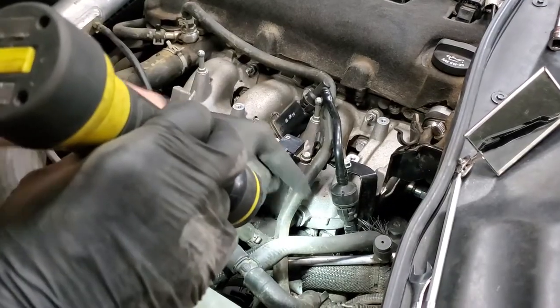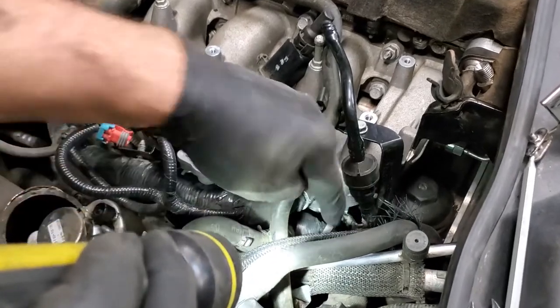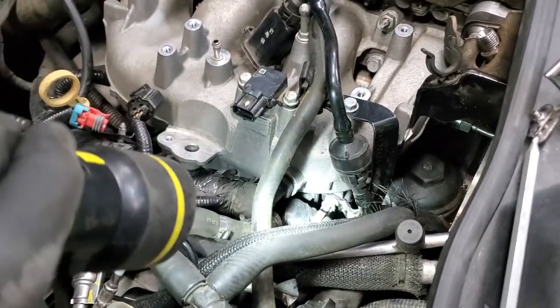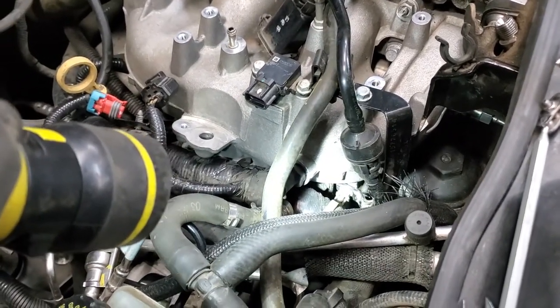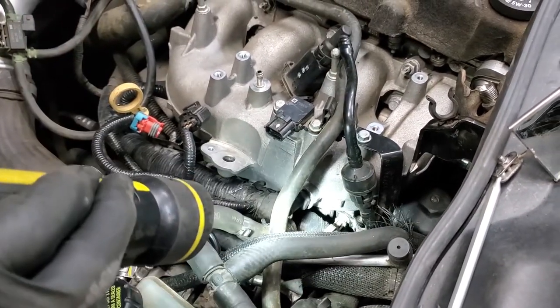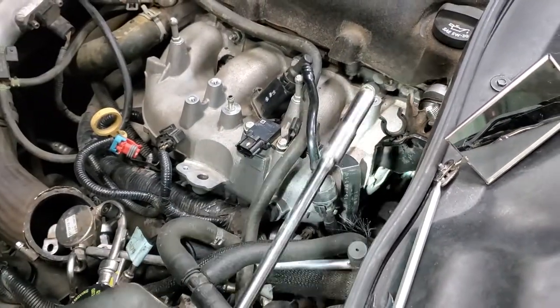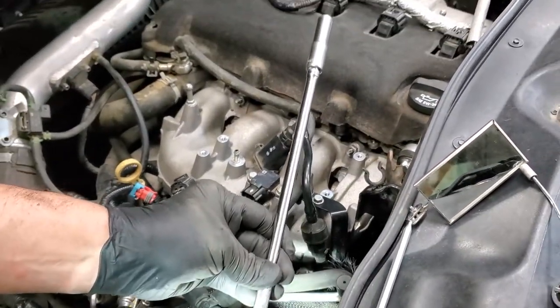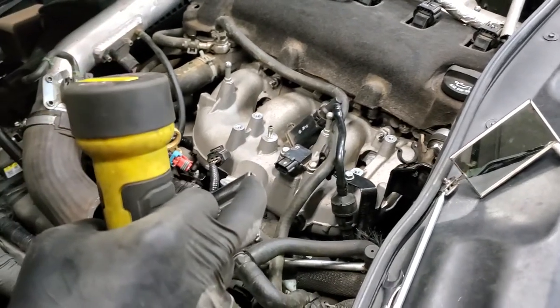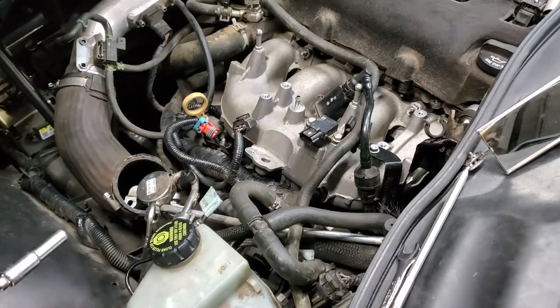All right, down in here, we've got the two bolts reinstalled, the 13 millimeter, which is on this side. And the one that's lit up is that stud bolt. You notice I put the clamp back on here. Now the way to put those back in that I came up with was to use a very long extension, put a neodymium magnet in there, and work my way, bring the camera over here, we're going to show.